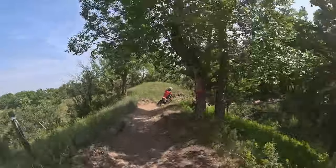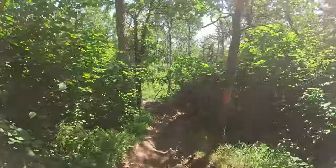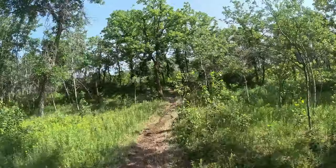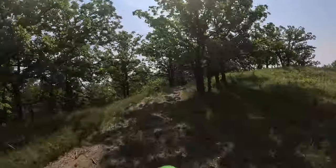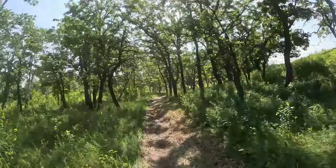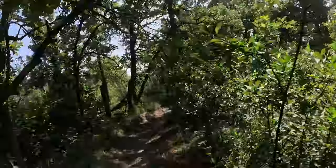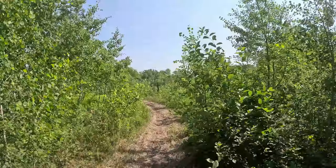They're going to a larger airbox as well — all for the off-road thing. On a track a 30-minute moto is pretty dusty, but off-road tracks get insanely dusty, especially sandy ones where you're doing an hour to an hour and a half of non-stop riding. A larger airbox gives you a larger surface area and more volume, getting more air in, and it won't get as affected when it does clog up — especially in the mid-range. I can notice the power difference between a clean and a dirty air filter no problem.